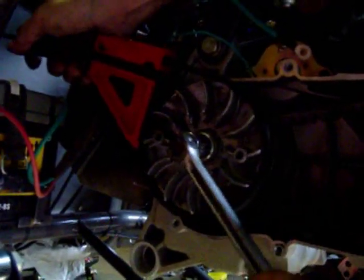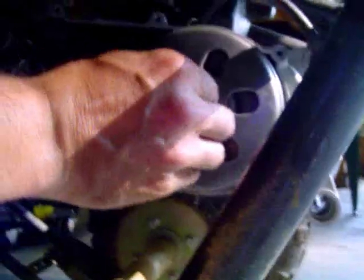I'm not having to put a ton of force on this while doing it. We're going to use our strap wrench and the ratchet to finish it off — I'm using a breaker bar in this case. Be very careful that you've got a good solid bite with your strap wrench because this variator sheave can be extremely brittle. Make sure you've got a good bite and tighten it up. Check the marks — need to go a little bit more to be matched up.